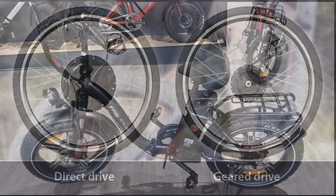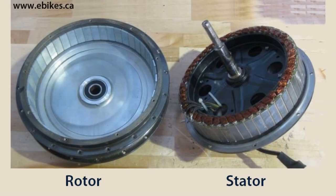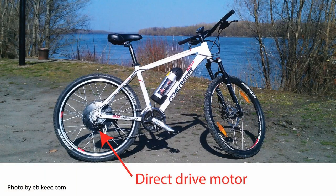If you opt for a hub motor, should it be a geared motor or a direct drive motor? The direct drive motor is a very simple one, composed of two main parts: the stator, which is fixed in place in the fork, and the rotor, which is connected to the wheel by the spokes and makes the wheel turn. For each revolution of the rotor, the wheel makes one complete turn. The obvious characteristic is their size — they are bigger and heavier than the geared motor. So it will be heavier to lift onto a bicycle rack or to take it up a flight of stairs.